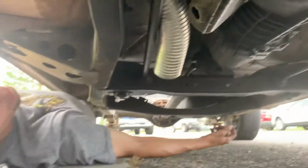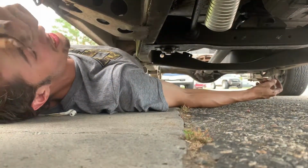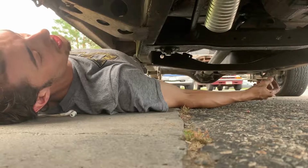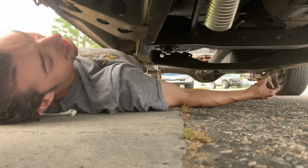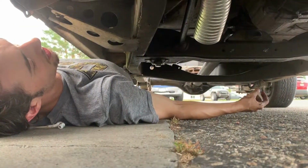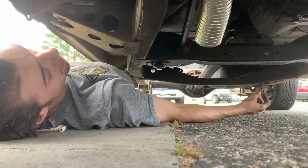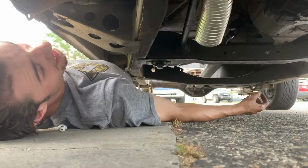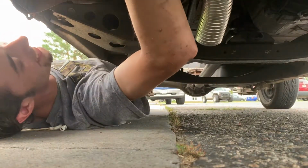And everyone says that when doing a 4-3 swap on one of these Luvs that you cannot use stock headers. Well, any of you watching and wanting to do it, just get the 2.5-inch flange and adapt it over to the pipe, a little bit of flex pipe, and you can get it to work, obviously. Flex pipe isn't the number one go-to, but it's gonna work for what we need at the moment. Clearance wise and price. Makes me so happy that we actually made it work just because everyone says it's not possible. Right. It's like, nope. Ha. Oh, so happy.